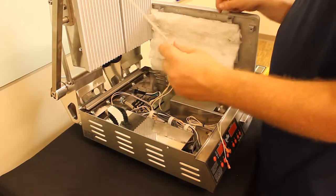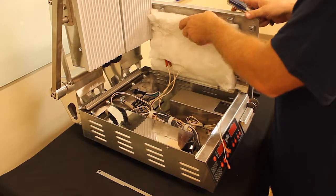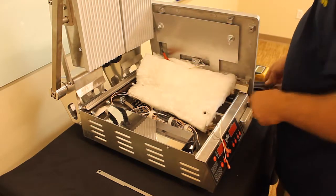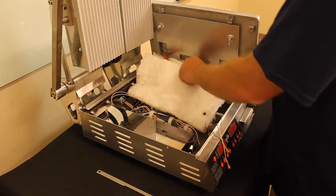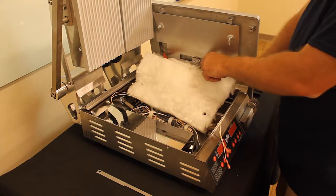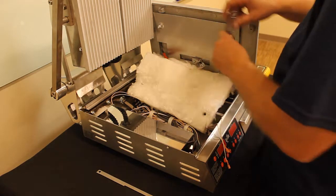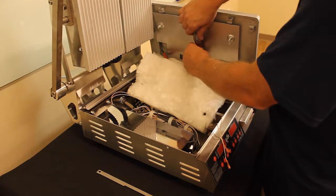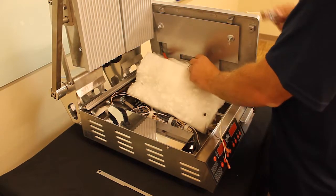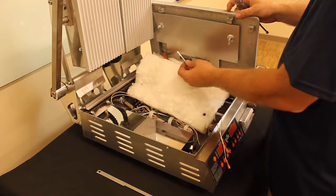You also have an insulation support that you have to remove. Next, you will take and drop down the insulation. Under the inside of the insulation, you will see the temp probe runs in here and into the bottom platen. You have 1 self-tapping screw. You do not need to remove it, just loosen it up enough to get the probe out. Once you have that loose, the probe should slide out of place.